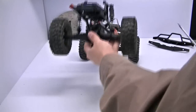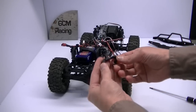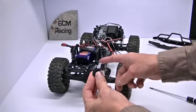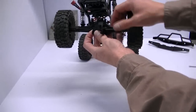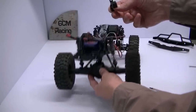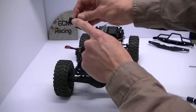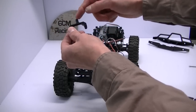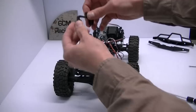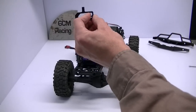Let's get this axle truss put on — this plastic thing has just got to go. We're going to start with the GCM aluminum bracket. This is a really simple unit that replaces the three-link center hole Y on the drive axle, using the same two screws in the back. That gives you a nice solid top link to bolt your four-link to in the rear. If you have a three-link, you can use the side hole and it's threaded for an M3 screw already — makes a real nice side link if you have a Panhard.